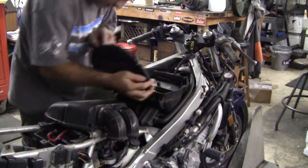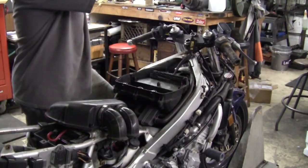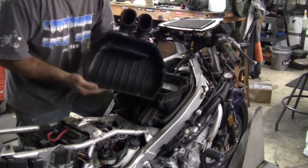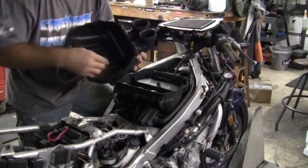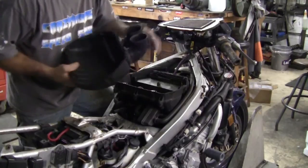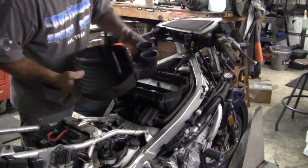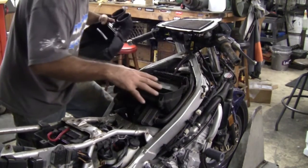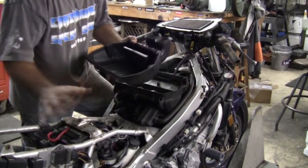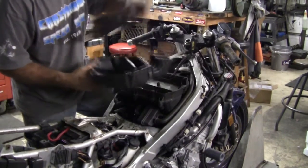This is our first look here. It's pretty clean — I mean, it's not full of oil, it's not full of big particles. So the filter's been in a long time, at least. We know it's maybe the original, or it's a K&N. Whatever — it's not caked in oil. So if you didn't know, it didn't flip over a bunch of times, it just sat. Because if it had, there'd be oil everywhere. So that's another good sign — so far so good with this one.